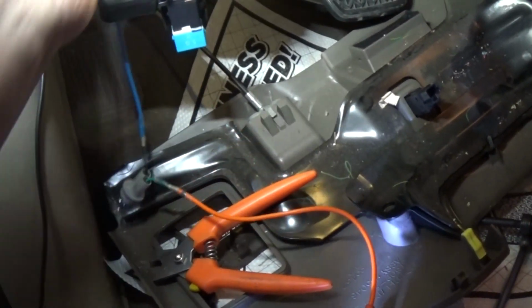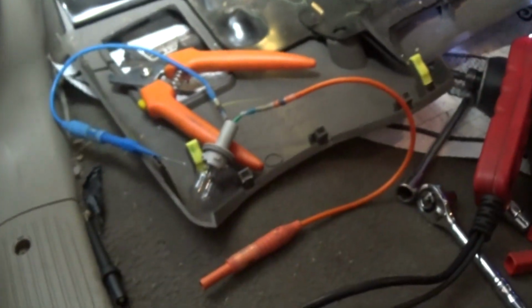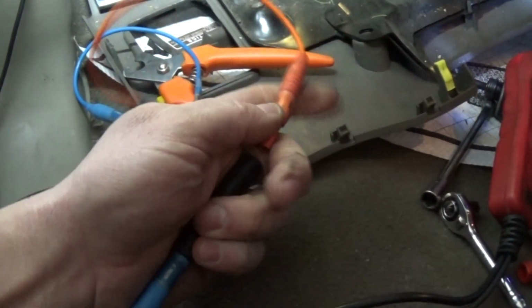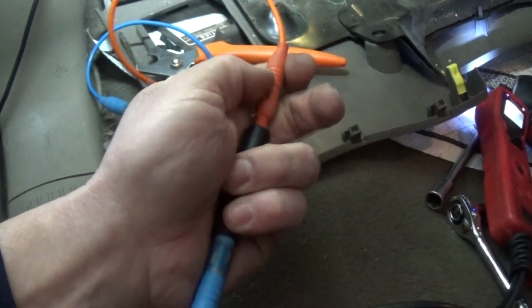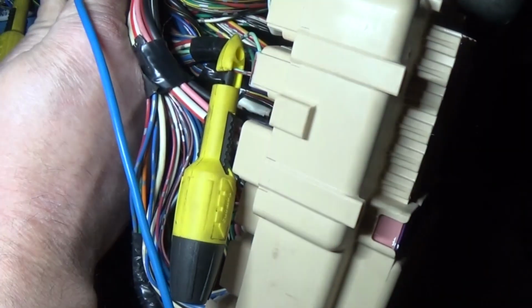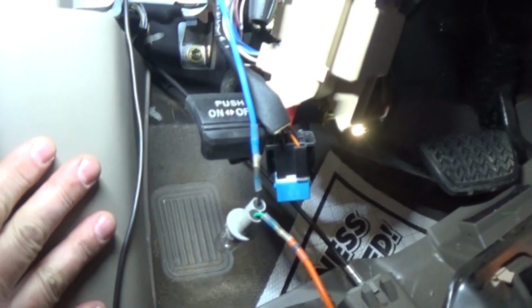We're gonna go next to check the power feeds. I'm going to move this to a ground. I'm gonna have on my power probe. Then we got this wire here, right next to ground. That's one power feed. That's good. And then this black, blue and white, that's another power feed. And this is the third one. And no juice. You got no power on this wire.